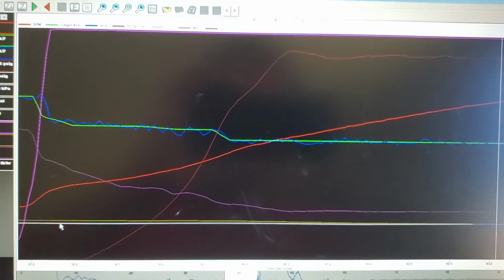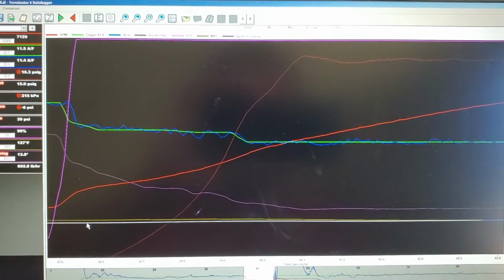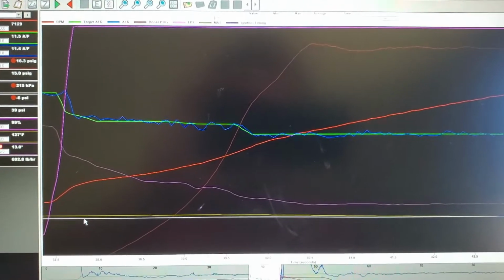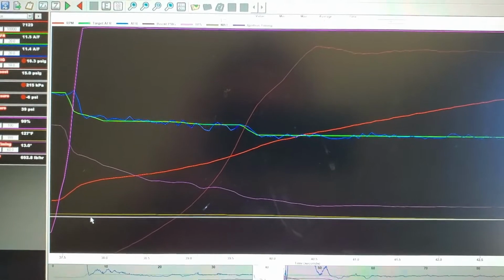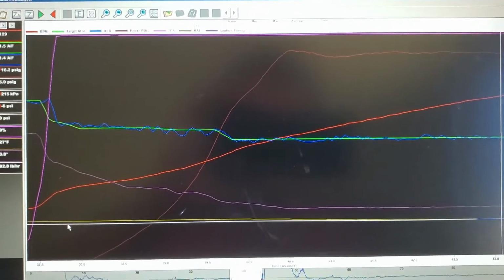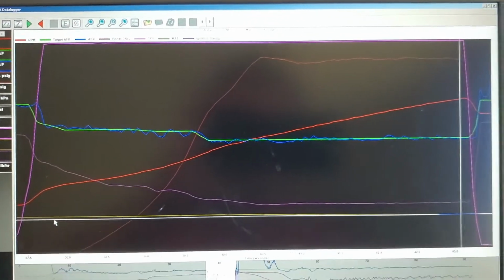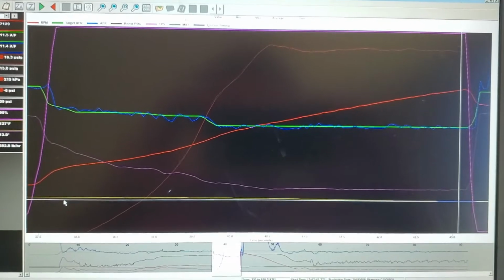But the sensor's mounted all the way in the back. It's a Holley high ram. It's all aluminum. And pretty much every time I cranked the car up after it got up to temperature, the air temp was reading around 150. So ideally I would want that in a charge pipe instead of the intake manifold, but it's not my car, and it still seems to work pretty good.